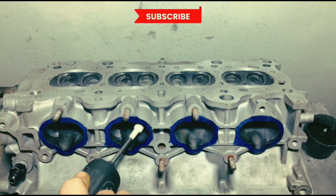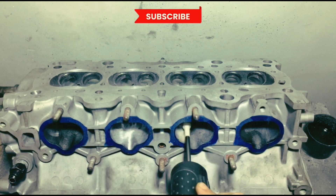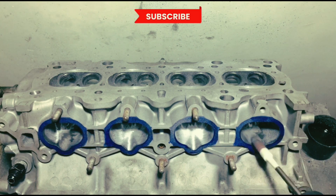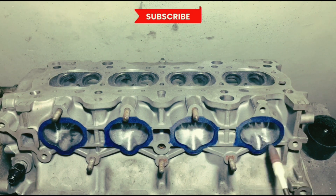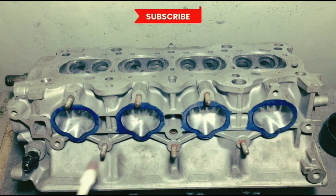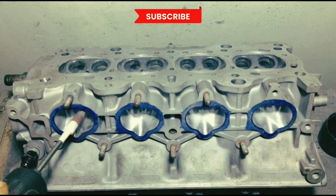Here we are on the floor — it's getting cleaner. We go back to the roof and spray it with an ethanol mix that has a bit of dishwashing soap, so it looks bright and clean and lets us visualize the whole port better. We can see the consistent finish. We'll make one more pass with the 80 grit just to make it really smooth and clean — and that's going to be the finished port.